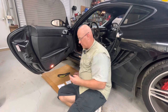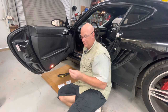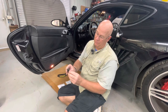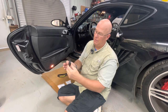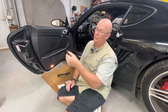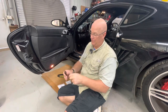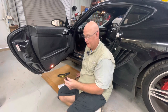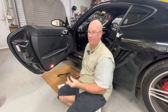I figured the problem would grow over more speed ranges and eventually not work at 75 mph either, so I went ahead and swapped them out. I have not tried hotwiring these, but they are super easy. There's a little notch on both sides and a gap — you just reach up, twist 90 degrees, pull it out, undo the wire, plug the new one in, push it in, twist 90 degrees. No tools needed.